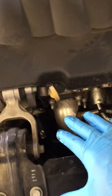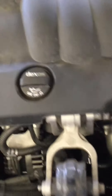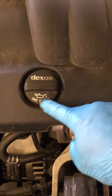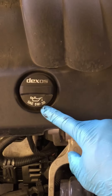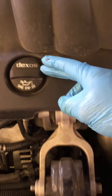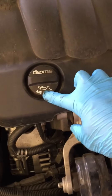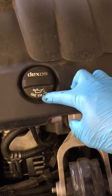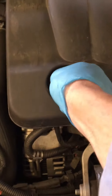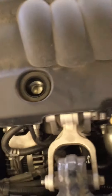I've drained the oil and I've got my new oil filter on. What do I do next? Where do I put the oil? Well, you're going to look for a cap that says SAE 5W-30 or SAE 5W-20 — sometimes it'll tell you the name of the oil. This cap is always going to be on top of the engine. Look for the sign — it's an oil bottle with a little oil drip coming out of it, and it'll tell you what kind of oil to put in. Give that cap a twist off — that's where we put the oil.